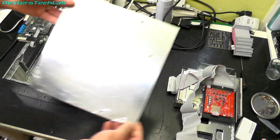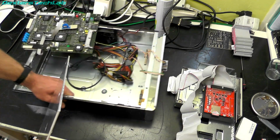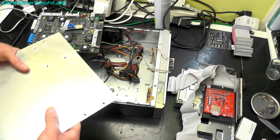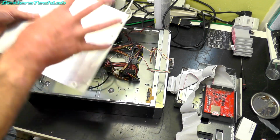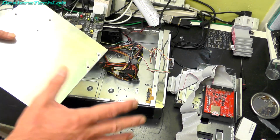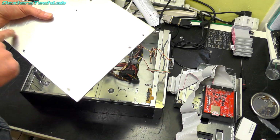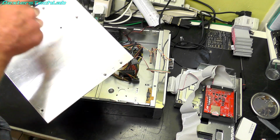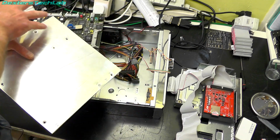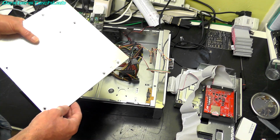The other thing that I've managed to do is make a small adapter plate, so this mounts into the standard case and converts effectively ATX and ITX into the Netcom. So the Netcom will mount onto this, and then this will mount into the case. So you're about to join me where I drill out the holes for the Netcom mounting, and I will tap a UNC thread onto those, put the standoffs in, and mount this board first and then put the Netcom on it.